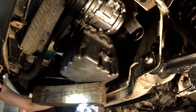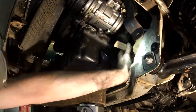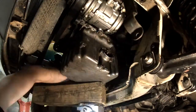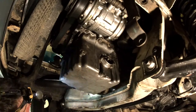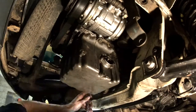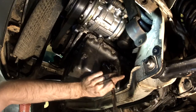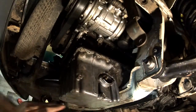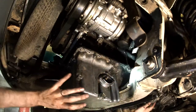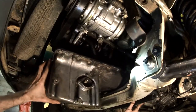I jammed as much wood as I could between the motor mounts and the cross member. I used Home Depot paint stirring sticks because they're thin, flat, you can cut them up, and they're free. I got it pretty close to as high as I could — it compresses a little under the motor mounts, which are new so they're a bit more elastic than collapsed ones. I remembered to drain the oil, but there was still some oil getting all over the place.